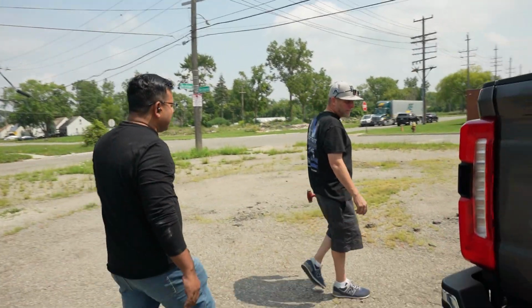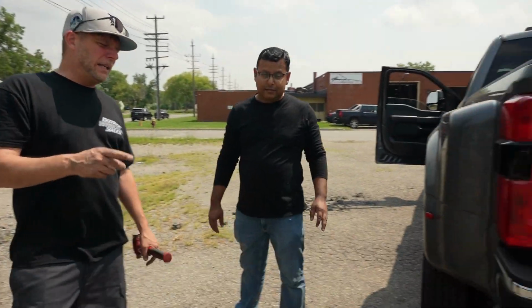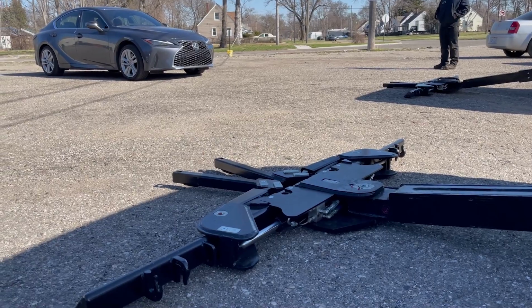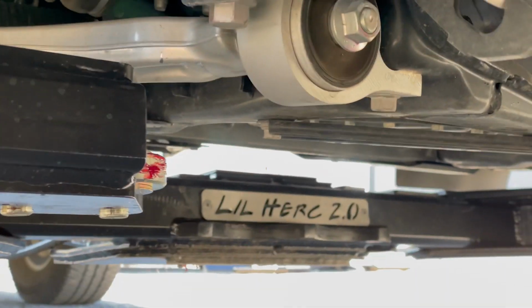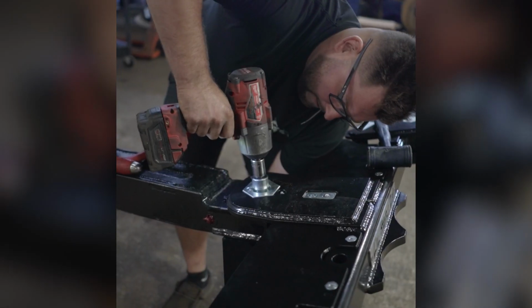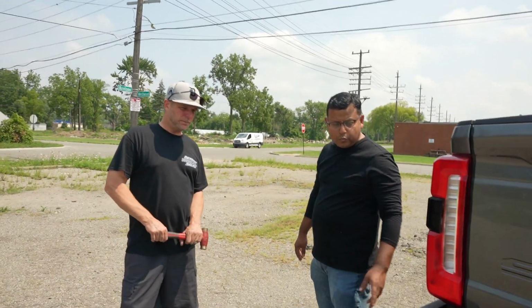So Mike, what about the oil pan? Most of the cars, we don't hit the oil pans, huh? No, I never had a customer hit an oil pan. Great question, because the pivot head is tilted up and it pushes the oil pan away from the crossbar. So every inch it goes up, it pushes it 2 inches away from the crossbar because of the angle. So I've never had a customer say, dude, I dented an oil pan. Because of the superior pin system, the angle of the head is all in your favor to not destroy customers' oil pans.